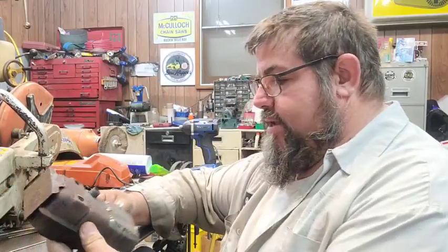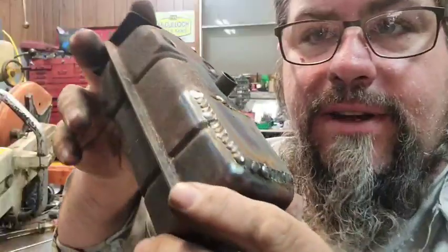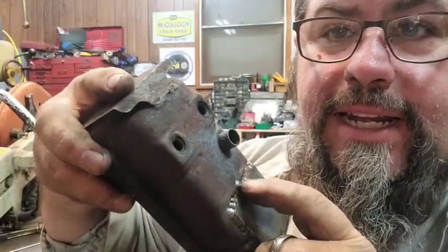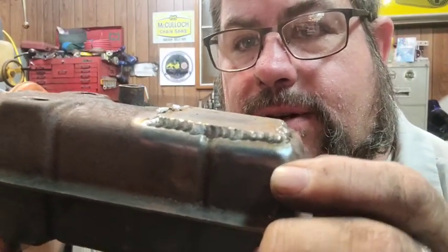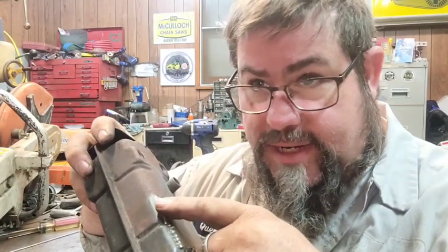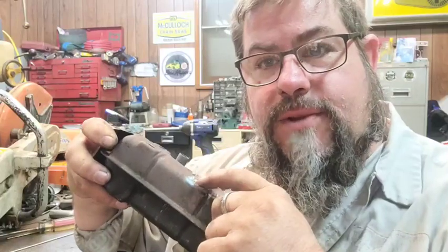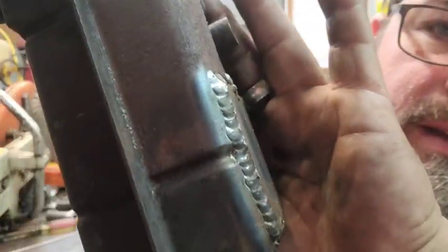I got her cleaned out. I went and cut my patch panel — I was going to use the slug and just weld it back in there but that little gap down here doesn't turn out the best. If any of y'all ever wonder when you're trying to weld thin stuff like this, it's really hard sometimes. What I usually do: this piece of metal is fairly thick, probably 3/32nds or so. I shoot the wire into the heavier material and let it melt down to the other — just burp, burp, burp, burp down the line. When you get it right, it ain't bad at all.